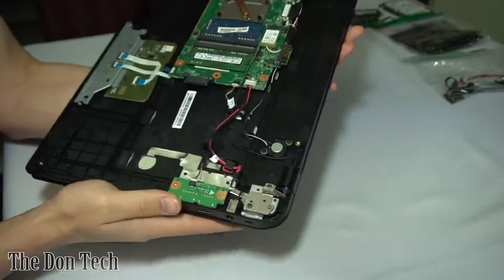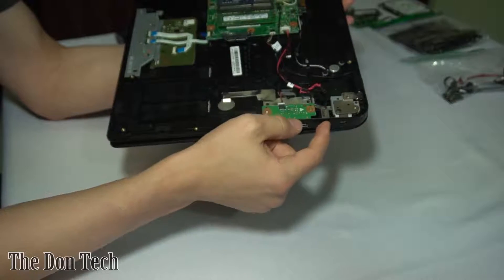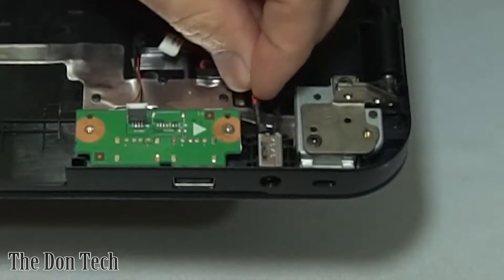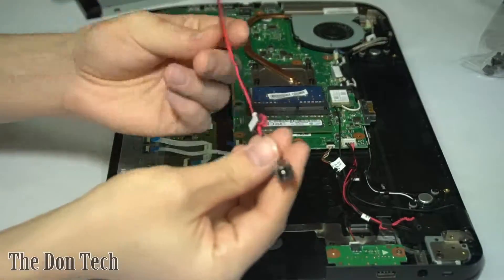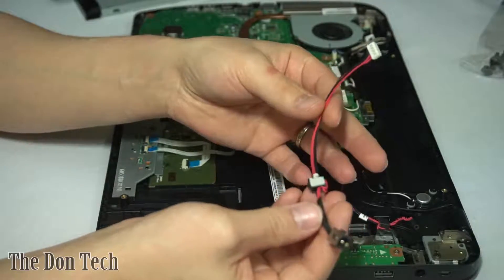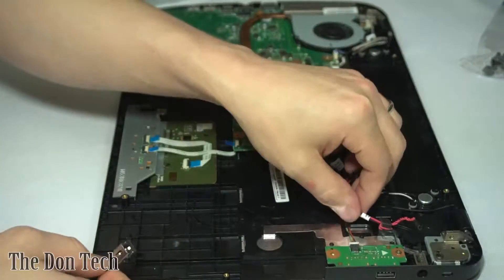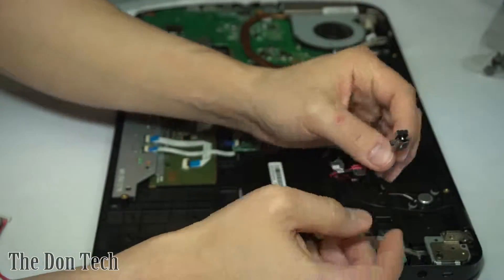The curious part is that since this one is actually a ribbon-style DC jack, usually the actual component itself won't break. But this one did break — it's one of these wires right here that actually came off one of the leads on the DC jack and just broke. What we've got here is our fully functional, presumably brand new DC jack. It's just a cable DC jack — same exact one. I had to pull this out to go ahead and get the model number that I needed. The DC jack mount will just come right out of there.